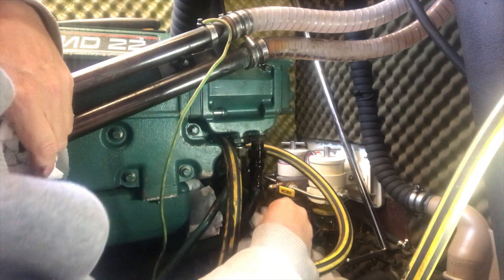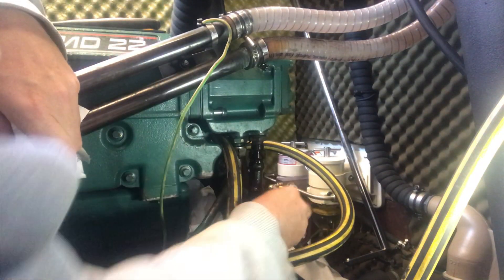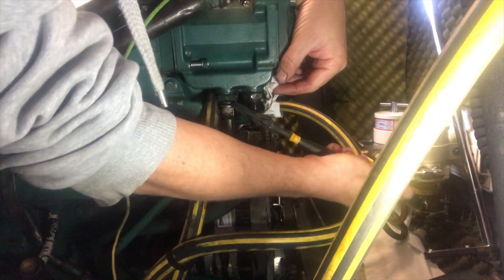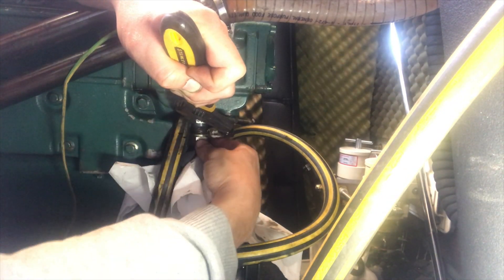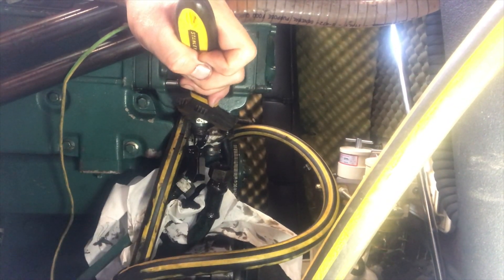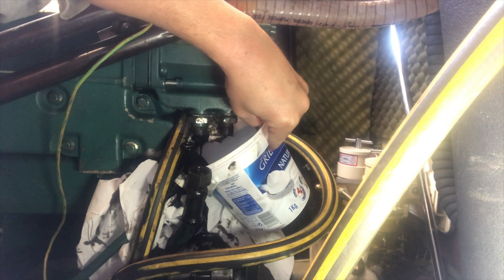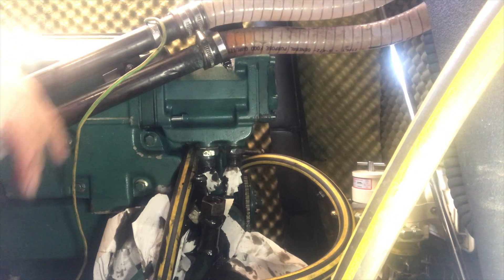I thought all the oil would have drained down into the sump by now because it's been a week or two since we've had the engine on, but obviously not. I needed to do an oil change anyway. I want to get an adjustable spanner in there, just enough to hold it off — I've got this pipe in the way as well. The nut came off but the pipe's still in place. There was way more oil came out than I expected — about a quarter of a litre maybe. I thought it would all drain down into the sump after a few weeks but obviously not. That wasn't mentioned in the manual anyway. So I'll take off the oil cooler now and leave it to drip in a tray.